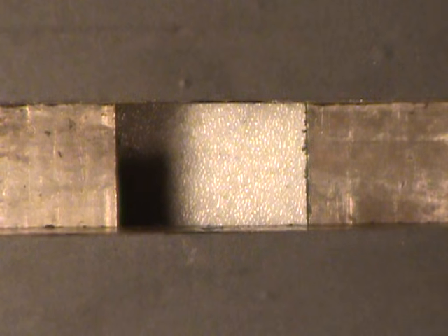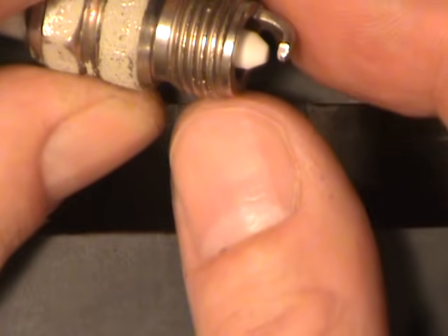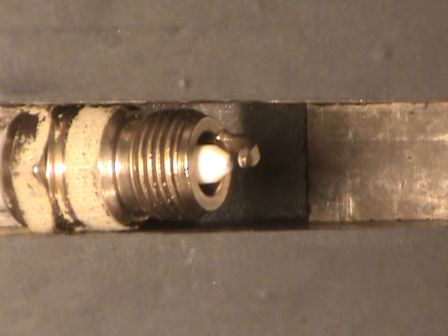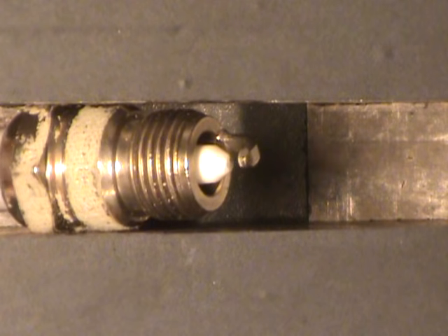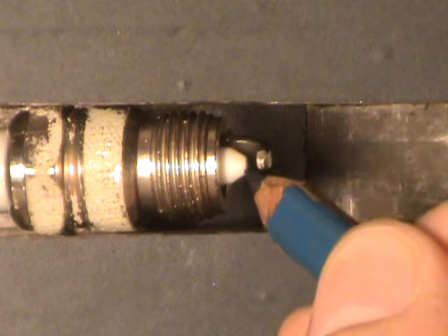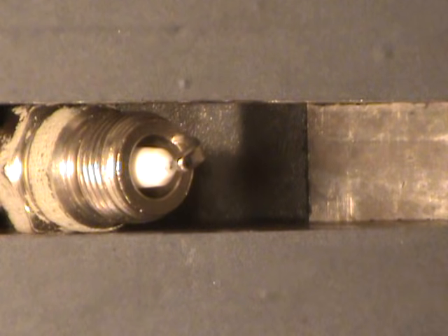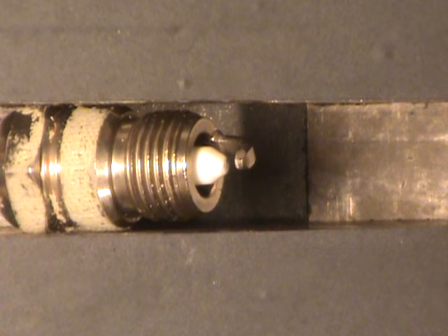With newer fuel injected vehicles, you'll get a plug that probably looks almost like this platinum-tipped one. In newer vehicles they burn a lot cleaner, maybe not pure white, maybe a grey color. The thing to watch out for if you have a really lean burning engine is the gap growth in here. The platinum probably won't be burning down as quick, but watch the gap growth on the outer electrode. If it's hesitating and bucking back and forth, that's an indication you might be running a bit too lean.